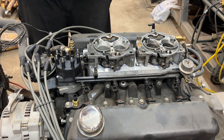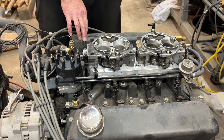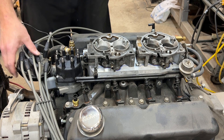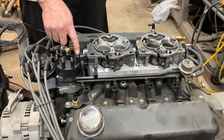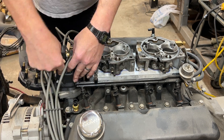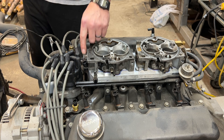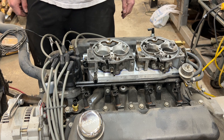I'm very happy with how all this fits together, and this gives me a little more clearance. It's still a little closer than I would like it to be, but there's not a lot I can do about it. This is not a perfect situation, but it is significantly better, and I think we will probably be okay. From there, it's as simple as transferring the plug wires to the new MSD cap, keeping in mind that this terminal right here is one, even though it's not marked as such. I'm extremely happy with how all that came together. I now have a little more clearance between my throttle position sensor and my spark plug boots, and disaster averted.